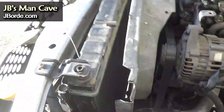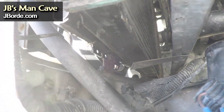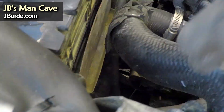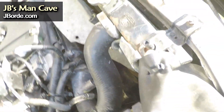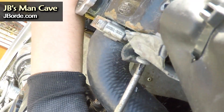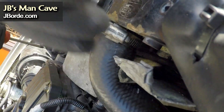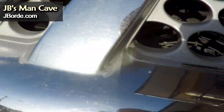It looks simple the way it came out, but making sure it's fitted you need those side mounts. I have another mount here on that side, and I'm also showing where I have a screw here. Notice how I cut around the radiator hose and added rubber — you don't want your shroud cutting your hose. The idea of it being there is to help, not make things worse. So if you're making it out of metal, make sure there are no sharp ends and no ends touching rubber.